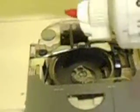That was easy enough. Now we take our sewing machine oil again, and right here in the center where the winder's at, see there, put a little drop there. Just one drop's all you need. A little drop over here to the side, right there where the bobbin case runs. This is the little LED light for the low bobbin sensor. So this projects a beam over here, so you want to make sure of course that's clean.